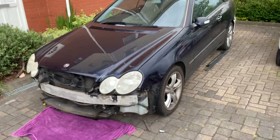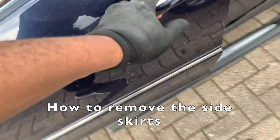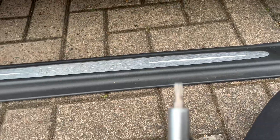The car is looking a bit sorry at the moment. For the side skirts, I've already pulled out the tabs. You open the door, see this Mercedes trim piece here, and pry it out with a flathead screwdriver — then pry out these tabs. Underneath I think there are some screws. You need a T25 — there's one, two, three, four, five, six screws right under here.